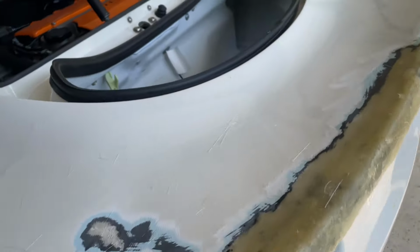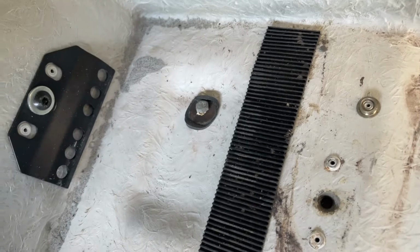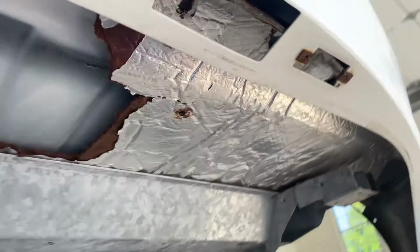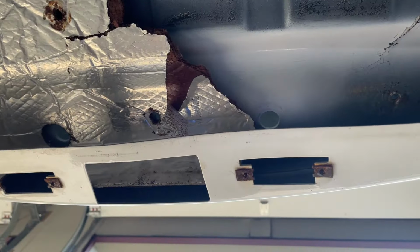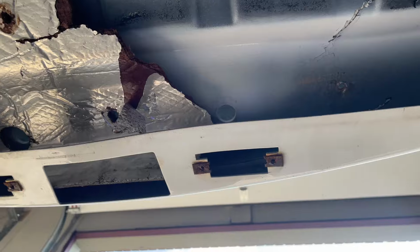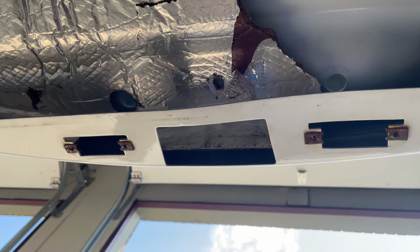On that side, there's a little one there that you're gonna pull out and pull through on both sides for the little side markers. And then after that, we're gonna start removing these 10mm bolts in the trunk area, or boot, if you want to call it that. All right. After removing the 4 bolts in the trunk, I've already got this removed, but your heat shield and your license plate holder is gonna have some bolts underneath here to where you're gonna have to remove those because they connect up to this guy. So be sure to do that next.